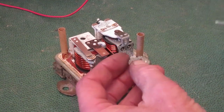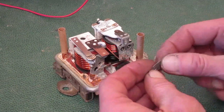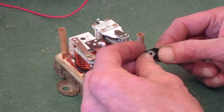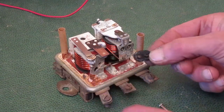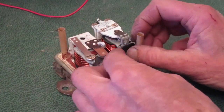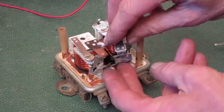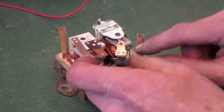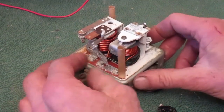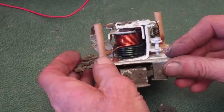This removable point is insulated, so there's a little metal plate that the screws tighten on. Behind that is a plastic spacer, and it has protrusions that go through the hole to insulate the screws. There's another plastic spacer behind it, so that removable point is sandwiched in plastic to keep it insulated from the frame. Like the other coil, there's a wire attached to the part you're taking off. This wire is thicker. You have to bend the wire to get the point out of the way.